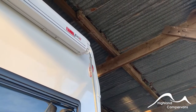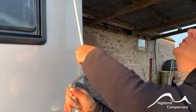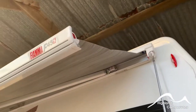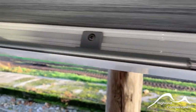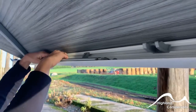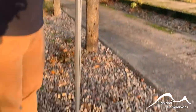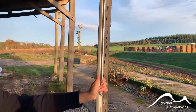The awning is designed for sunny conditions, so in windy or wet conditions we would advise you put it away. Put the hook through the eyelet at the end and begin winding the awning out to a convenient distance where you can take hold of the pelmet and reach the legs. At the end of the pelmet you've got this leg support — pull that out through your fingers, then unclip the leg from inside the pelmet and rotate each leg down in turn.